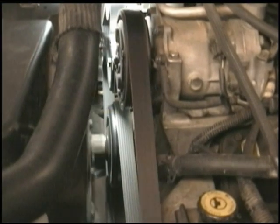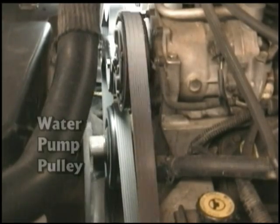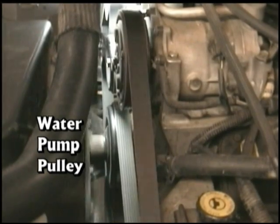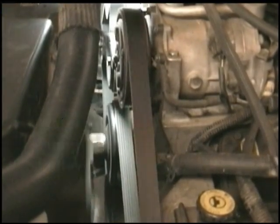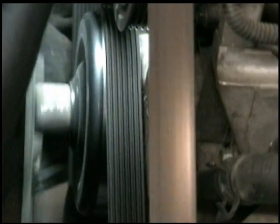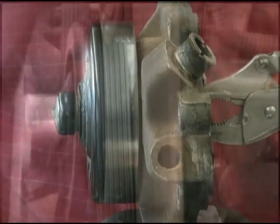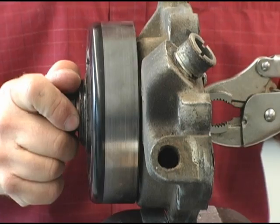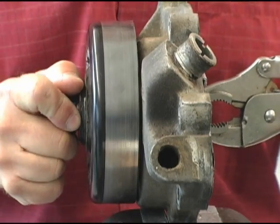Another seldom diagnosed cause of misalignment is the water pump pulley. If the water pump isn't leaking, it's okay — right? Wrong! This belt is creeping out of alignment upon acceleration. The water pump has a bad bearing and should be replaced. Here is that same water pump on the bench in a vise. Notice how much free rock is present in the pulley. The belt is constantly pulling the pulley out of alignment, a condition that is magnified during acceleration.